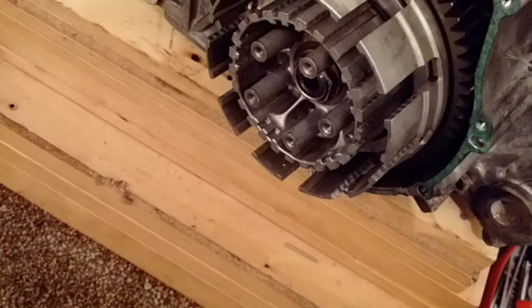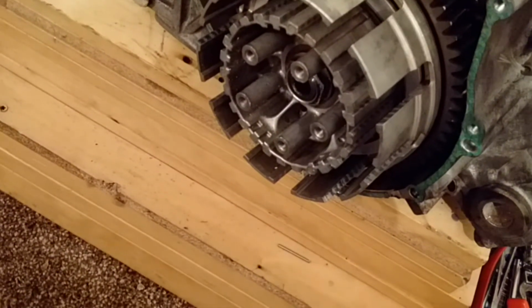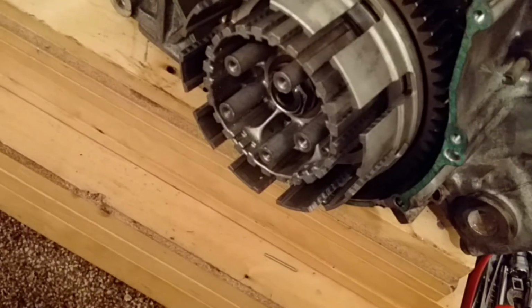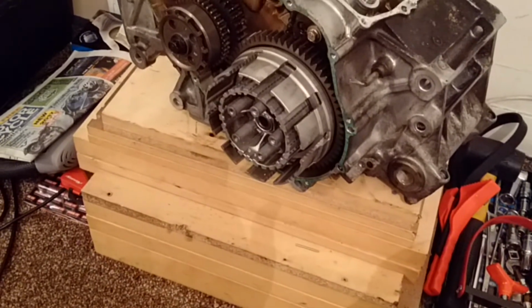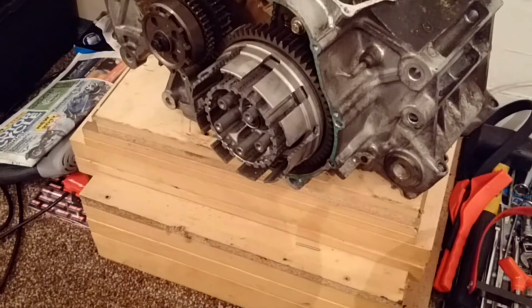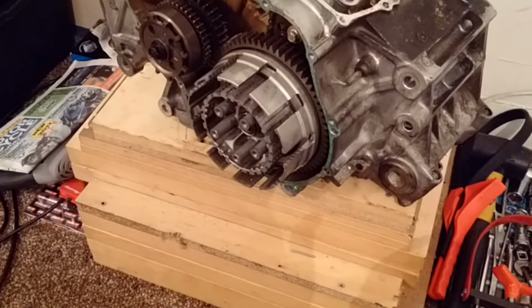It's 93 foot-pounds. I can undo 93 foot-pounds, I'm pretty sure, because I've undone 80 foot-pound nuts on the rear spindle of various motorcycles, or around about 80 foot-pounds. It's perfectly doable with a 600mm breaker bar. It's perfectly possible to break it loose, but I just don't have a way to hold that, apart from putting a chain on the sprocket, which is my next best idea. So I'm going to see if I can get hold of a second-hand chain, and then we'll give it another go.